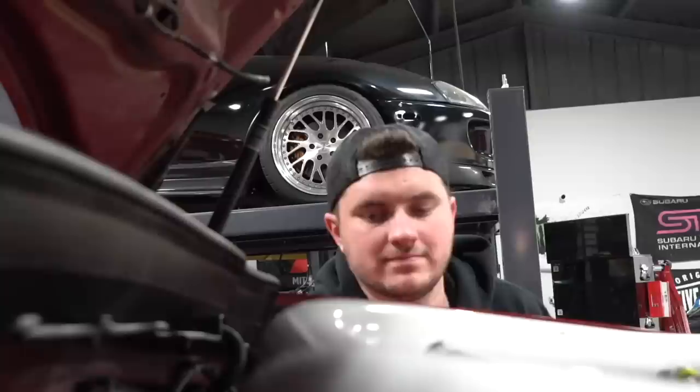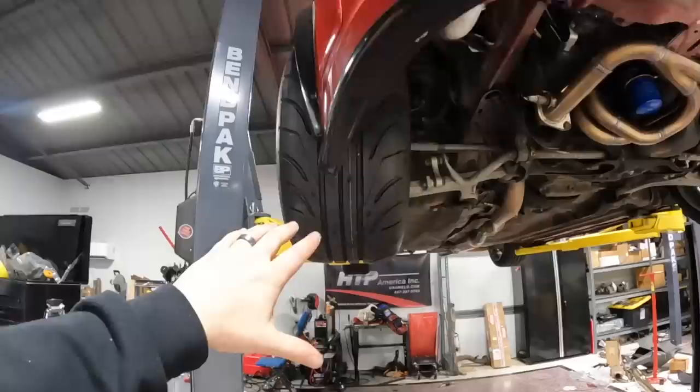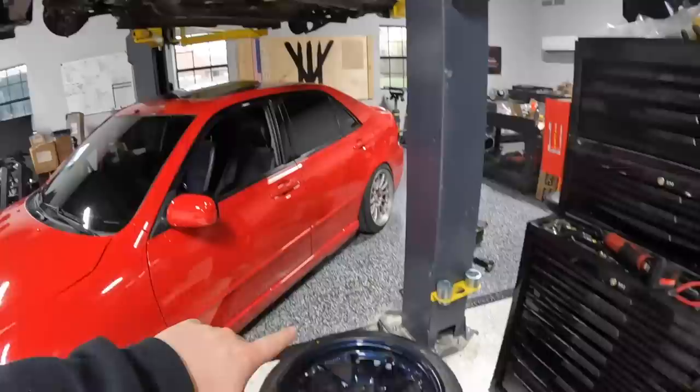I changed the alignment on the front. Thankfully I have adjustable top hats on the front coilover so I was able to get some negative camber. Fitment is great. The rear — I have ISC rear lower control arms and toe arms so we can fully adjust the rear suspension. I want to keep this a pretty functional height because I love driving cars and I'm tired of making cars I'm not fond of driving. I'm not 22 years old anymore. Big thank you to Tire Streets — they're our new sponsor especially for the 2023 drift season. We're running Accelera tires on all my race cars. We got Accelera 651 Sports on the CE28s for the S2000, and 651s with 200 treadwear for the STI.